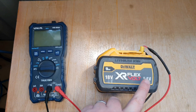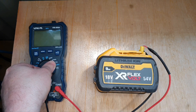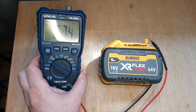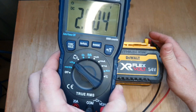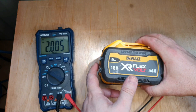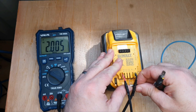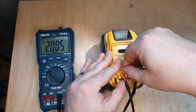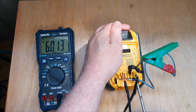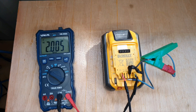Hello and welcome to my channel. Today we've got this 9 amp FlexVolt 54 volt slash 18 volt battery and this one isn't feeling too well at the minute. It's showing no bars and you can see the voltage is sub-optimal — this is 2 volts, not 20 volts. And if you put it to the 54 volt range, which you can do by connecting the C1 and C3 terminals and giving this slider a little push, it's only showing 6 volts at the 54/60 volt range.